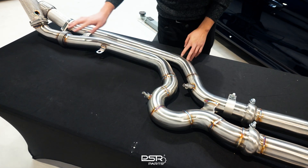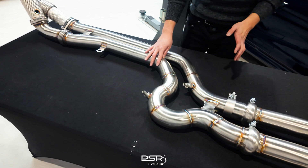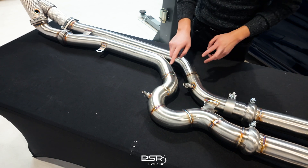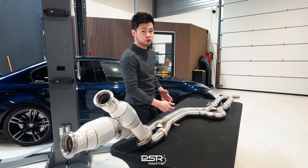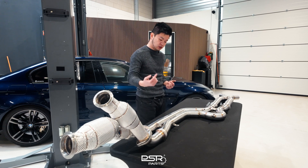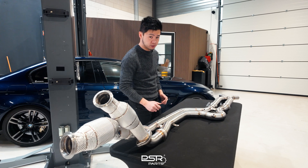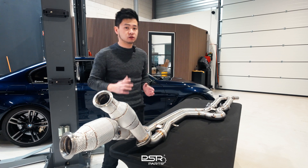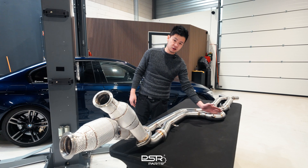This is the exhaust pipe we're talking about. We already explained the difference in length — this is the left pipe and this is the right pipe. This pipe compensates for the shorter downpipe length, which is why it has these bends. There's a small difference in length between these two pipes, and that's intentional. Why do we call it equal length when there's a difference between the two pipes? Exhaust pulses are not static. If you measure the center line there is a slight difference between left and right bank, but at the point where they mix, under load, the actual exhaust flow meets at the same time.